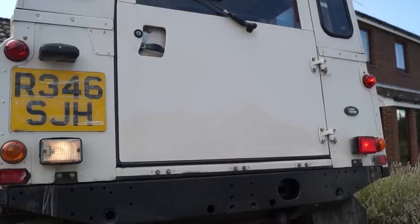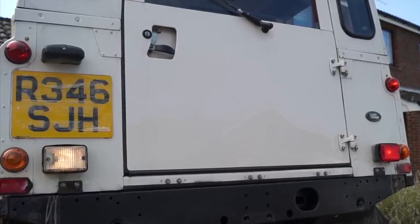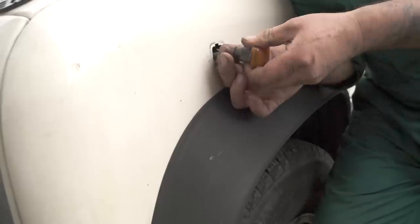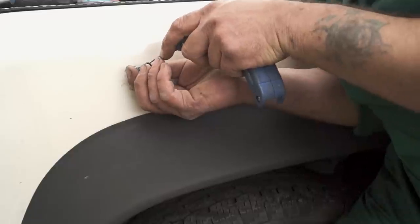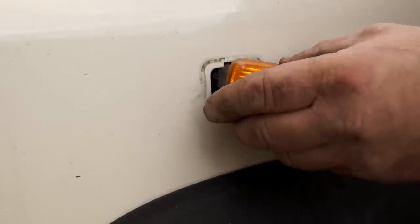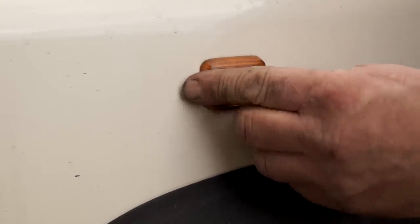The stop lamp that was inoperative actually turned out to be a loose bulb — it wasn't seating properly in the bulb holder. The side repeater lamp, which happened to be an intermittent fault on both sides, was dodgy contacts. It was a matter of cleaning the contacts and squeezing them together slightly so the bulb would fit in properly again. This is an issue with capless bulbs, however everything was working and they're still working now.